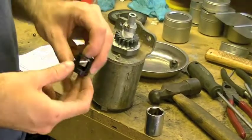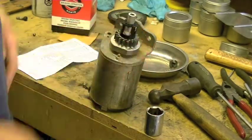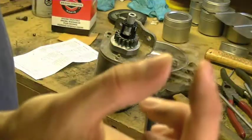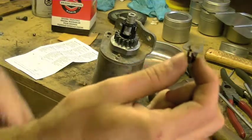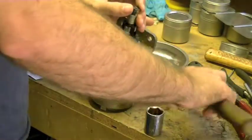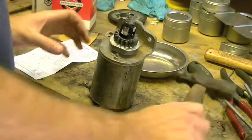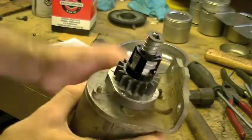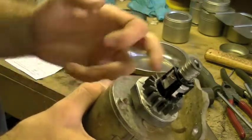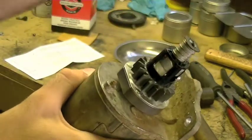The next piece to go on is the little plastic cage, which drops on top. Then goes on the new spring, followed lastly by the metal clip which just pushes into the top — tap it in with a hammer. And there it is, good as new. It doesn't really matter how rough you are taking it apart; the kit comes with all the new parts you need, as long as you're careful not to bend the actual shaft on the starter.